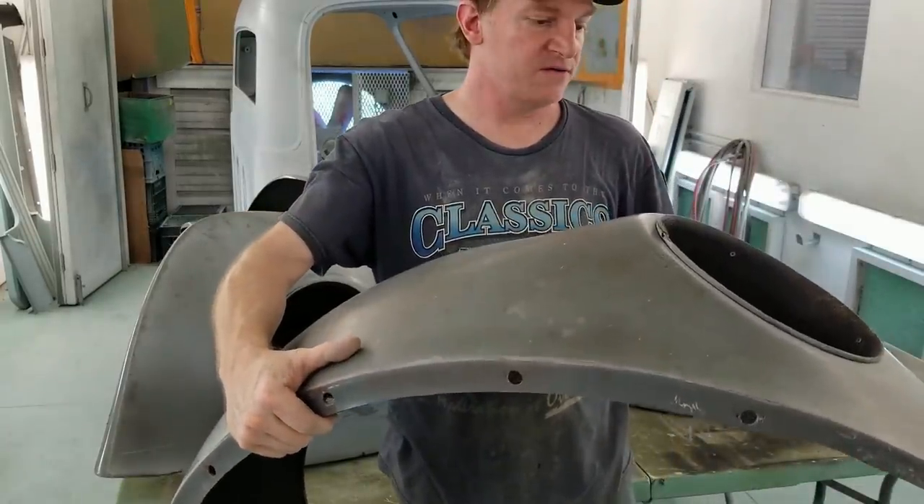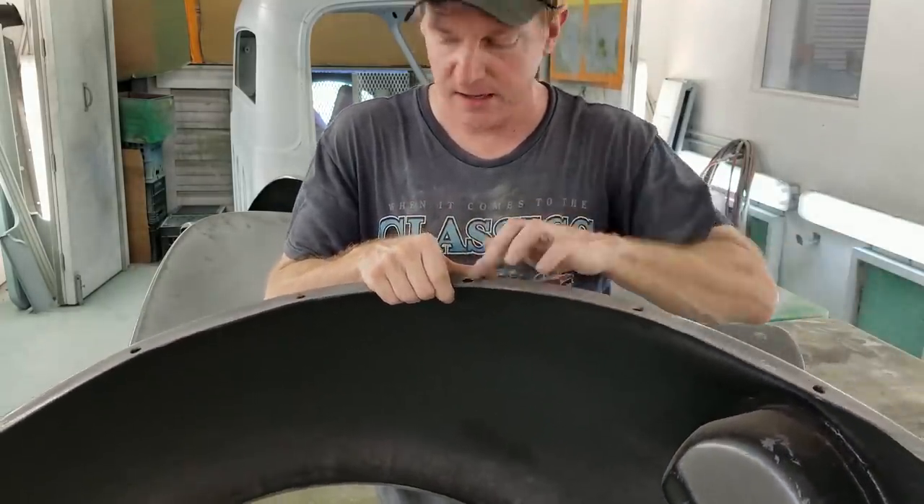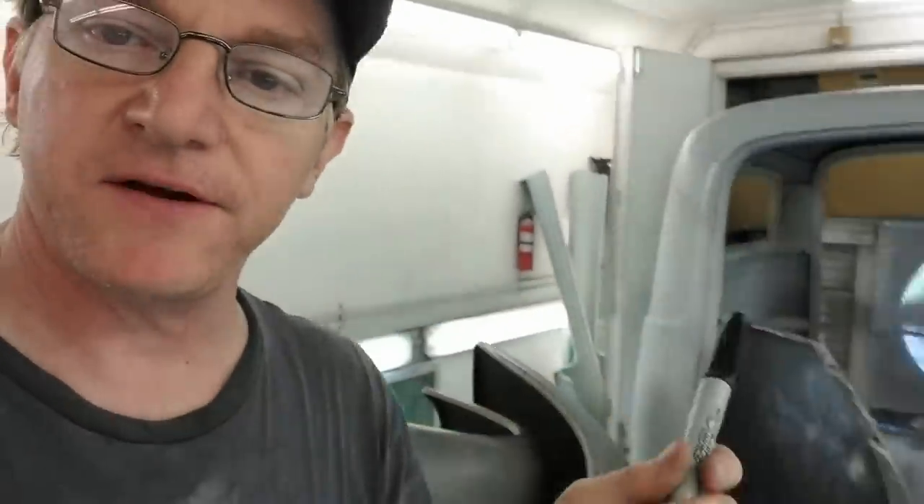Okay everyone, wanted to show you what was going on with the fenders. Let's see what we can do to get these in shape so the structure will hold again. Now that I've inspected these fenders, the next thing is I'm going to make sure I've got every crack marked. The reason is every little spider that happens in the gel coat will come back to get you. So you want to dig it out and make sure the gel coat over the glass doesn't have any air pockets. If it does, you're going to have to backfill it and dig down as far as you can. We're going to mark every inch of these, then go in and Dremel them out, then put our gel coat back in.